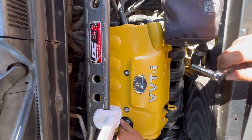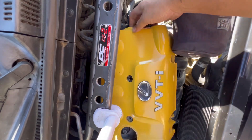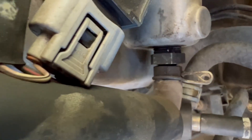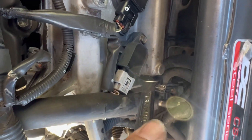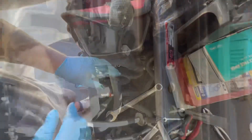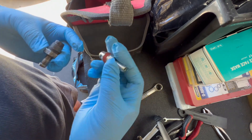I'm going to take off the cover. Your PCV valve is right there in the back of the valve cover. I'm going to take it off and check it, and then we'll see the difference between the new one and how clogged this one is. Let me take this off and then we'll put it on the table and see the difference. It is right there in the back. Let's do a little before and after — old, new. You can see the new one is nice and clear in there, and it already comes with a silicone seal for the threads.